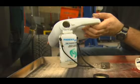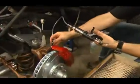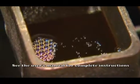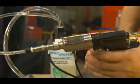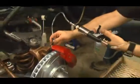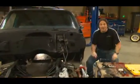Basically, all you have to do is fill the reservoir, connect the brake bleeder to the bleeder valve at the caliper, and pump the handle. The air bubbles will exit out through the reservoir of the master cylinder, and once the bubbles stop, you're done. A couple of important tips for successful bleeding: make sure you prime the tool with fluid before you use it so you don't push air up the system, and make sure you burp the caliper or wheel cylinder before you close the bleed screw so there's no air trapped inside. In just a few short minutes, you'll have the best, firmest pedal you can get.